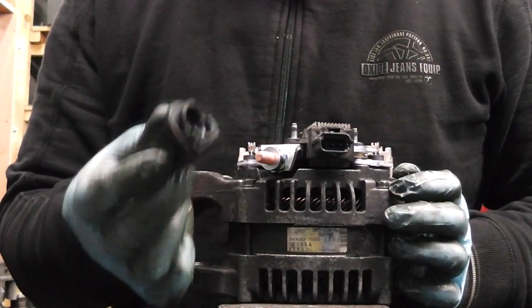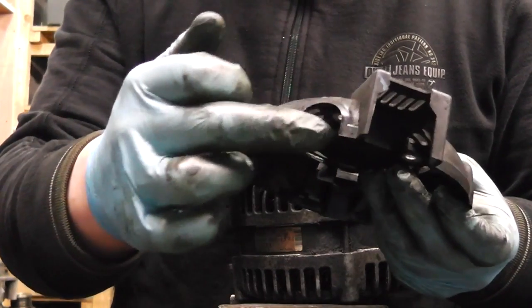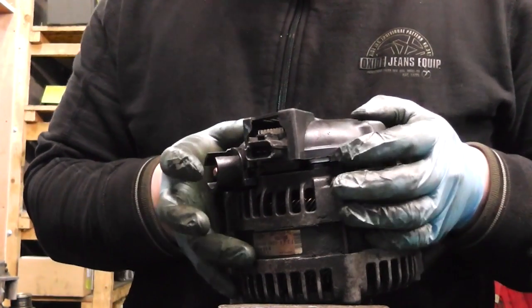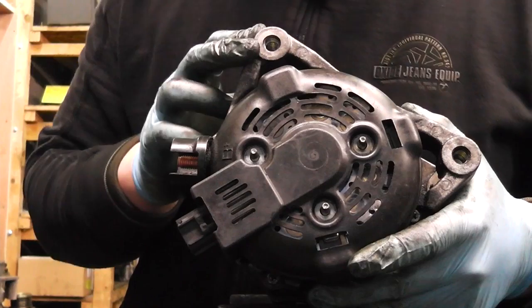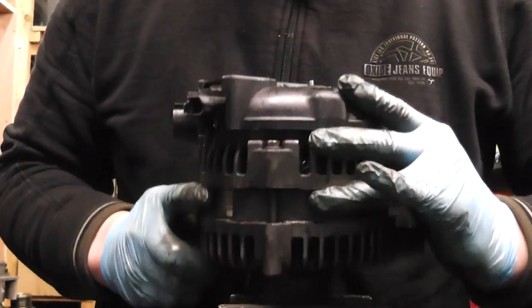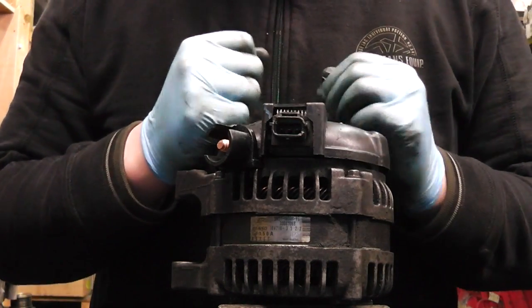Get the plastic insulator and slide it inside the bolt. Take your cover — the openings will always match the regulator and the positive bolt — and just slide it over. Put your three nuts back onto the cover and tighten them. If you've seen the diodes burnt and the sticker is nice and shiny, you can be sure this repair will solve your problem. But if the sticker is brown, burnt or shriveled, the stator is more than likely burnt out too.